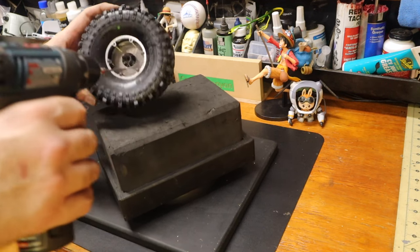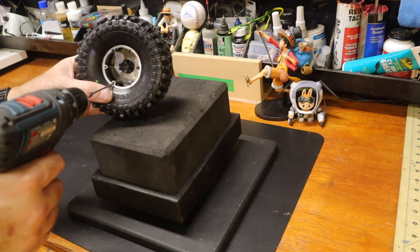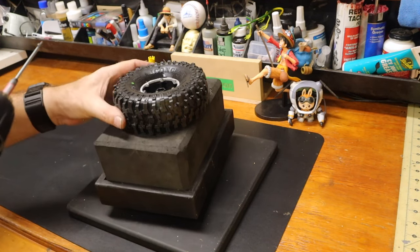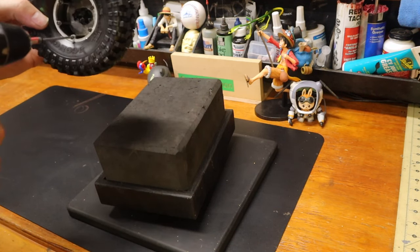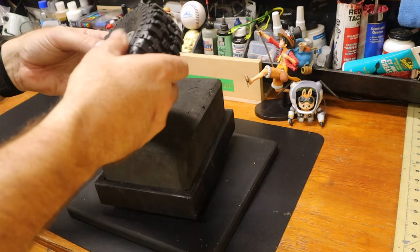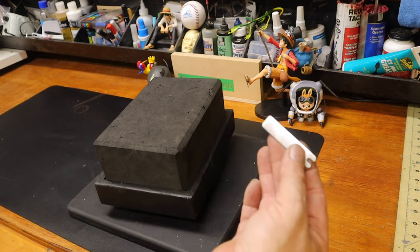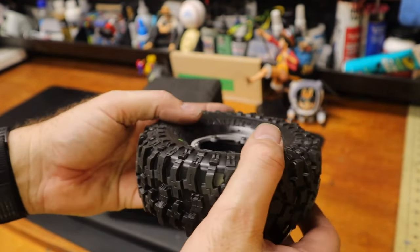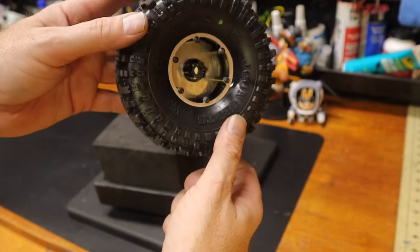Usually by the fourth one, I've got it down. Even tough to mount stuff, unless it's stuff that proves to be nearly impossible to mount, like there's no lip in the tire. These are easy enough to mount the tire. But that insert is so catastrophically enormous that the way I end up having to do this, this would be better if it was wood, if you had a little wood tool, I get it up on here and I just push the lip under to make sure that it's in the ring. And I know I can go back and check it, and you can see in there, you can see the lip all the way around.